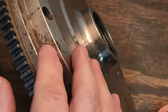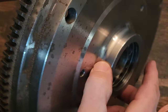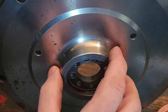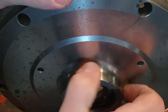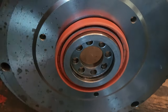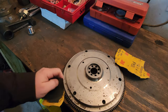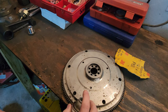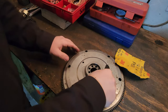If you have an older flywheel with surface rust, you need to clean that surface up and polish it nice. Feel it — does it feel rough? Take some 400 grit and go up to 1000 grit sandpaper and really polish it up good, because that's going to help out with break-in. Mine's not too bad, but I'm going to take some 600 grit and a little bit of lube — this Frio, it's good for all kinds of stuff — and just go around and clean it up nice. I want a smooth action on this.